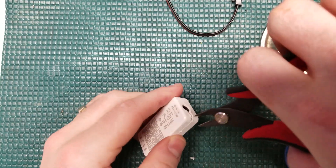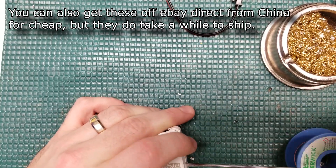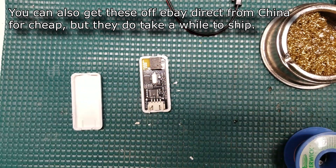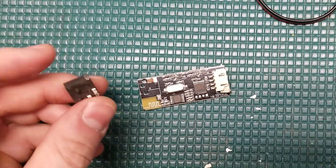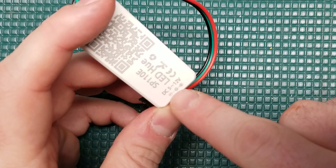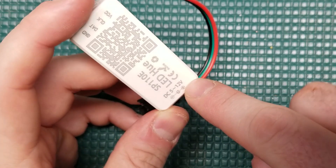The specific RGB LED controller we're using is the SP110E — I'll have a link in the description so you can pick it up from Amazon. Now, while ripping this thing open, I accidentally ripped off the power plug. At the end of the day, it's no big deal — we're going to solder directly into the power and ground on the board, and we don't need a plug. They printed the polarity of the power jack, and we know it's center tip positive. This will help us know where to wire our positive and ground on the board itself.